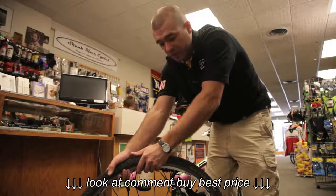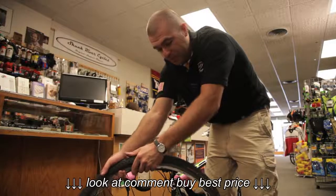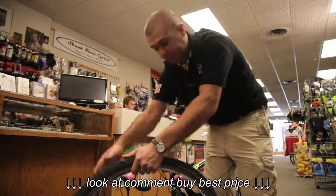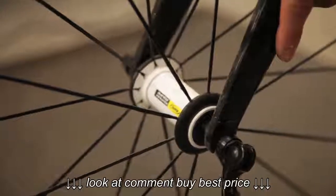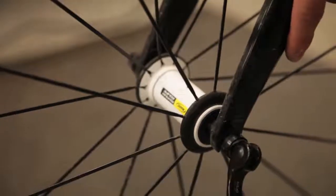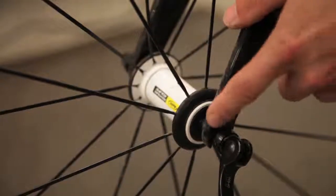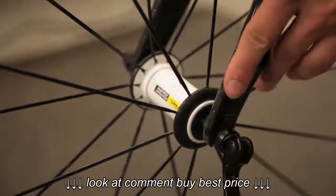When you've reached your trailhead or you're done with your tire change, you're going to put the wheel back in the fork and engage your brakes. To do this, place the fork back on the axle. When you do this, you never want to have the front wheel off the ground — if you do, the wheel could end up crooked in the dropouts and rub on your brakes.